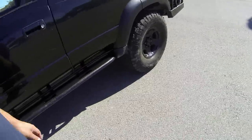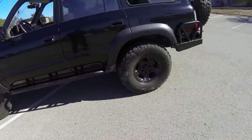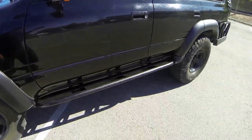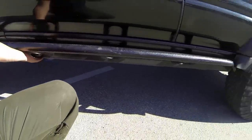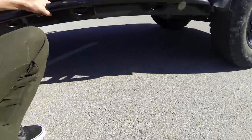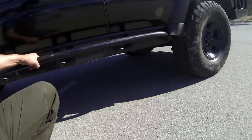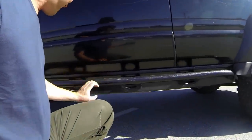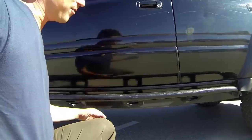These are sliders — Slee sliders. Go to Slee.com; they've got great products especially for the FJ80. These sliders are very stout. When you're on the trail you use these all the time. You'll rest the rig on a rock and literally slide down until it hits the back tire. They also have armor underneath to protect the bottom of the rig. Don't buy running boards and don't buy something cheap because you'll just bend them up. Also, don't put steps on your slider because you'll rip those steps right off when you're going through rocks.